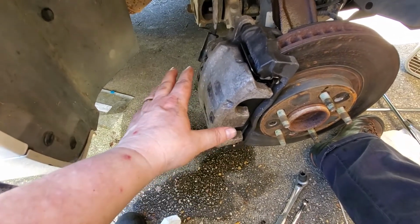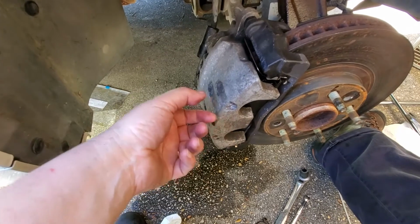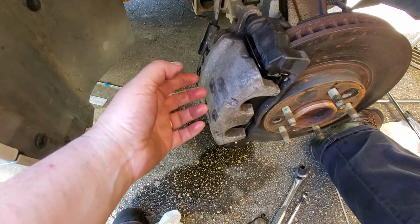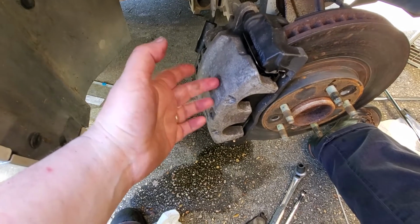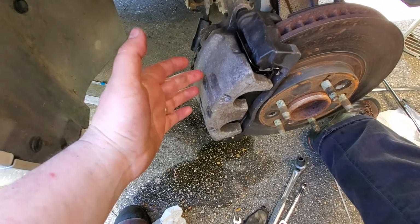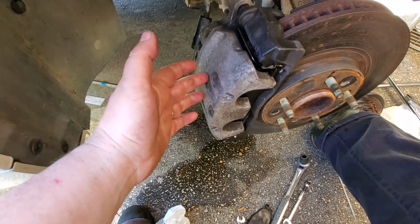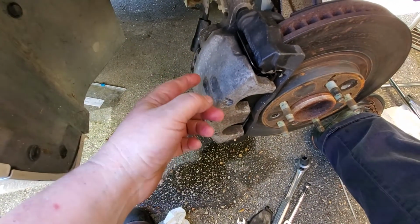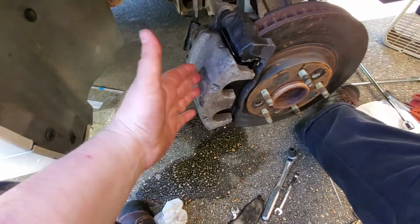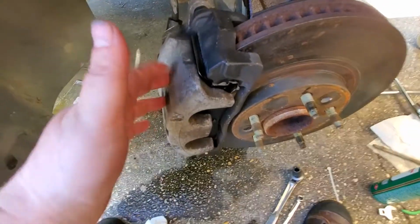Remember we took it apart and we took those caliper pistons and we were trying to put them in and they would stick? Well, that's what the problem was, it would force those pistons down and they would bind up inside this caliper. So before we could use these, we needed to put about 1/1000, 2/1000 clearance all the way around that hole that those pistons went in. We needed to recondition those pistons and hone the inside of this caliper right here.